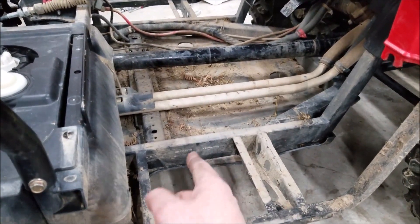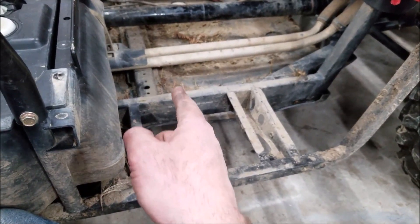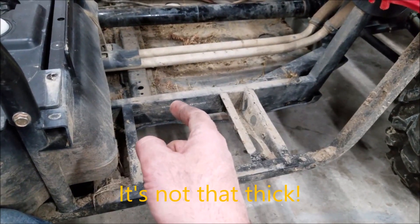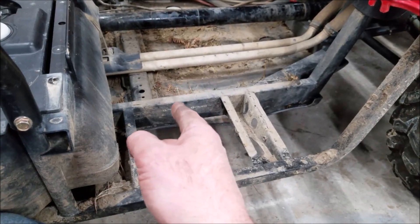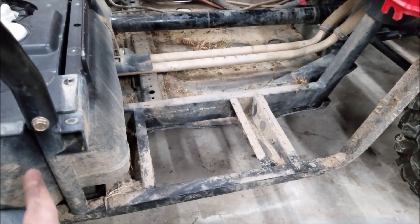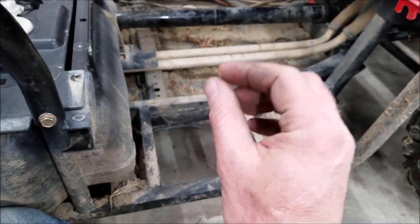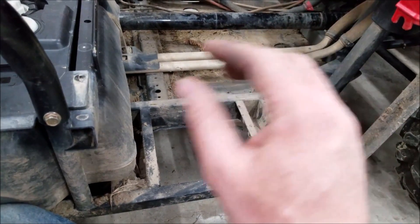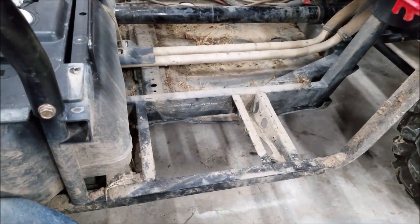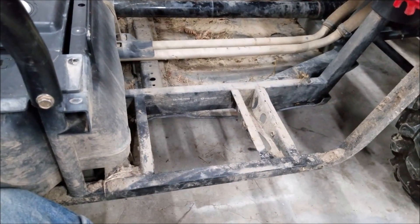The frame is one inch wide by two and a half inches tall with an eighth inch wall. On the inside I can take three quarter inch square tubing — I'm gonna put three pieces on top of each other and sleeve the entire length of the frame. That way it's super strong because it'll have three pieces of three quarter inside, turning into a quarter inch wall on the sides and top, plus laterals going down the middle. That's going to super strengthen the frame and allow me to extend this thing twenty nine and a half inches.